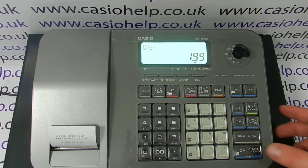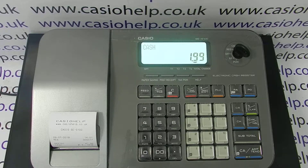Conceivably, the only other way you could have a problem with the receipt not printing would be a problem with the paper loading — paper not loaded correctly or the platen arm closed down — but that's unlikely to happen without the till displaying an error message which should point you towards the problem. Every time I've taken a call to do with this machine with the paper not printing out, it's been resolved by the paper saving issue, so that's worth checking first.